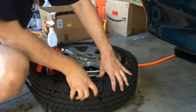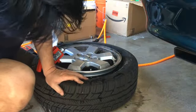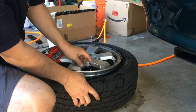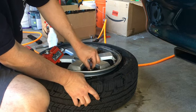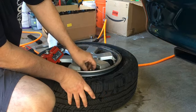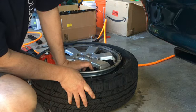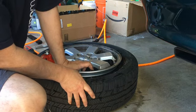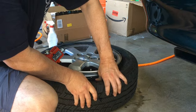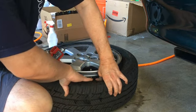I'm going through this relatively speedily because this is the third time I'm doing it. One thing to be aware of: here is the valve stem and the tire pressure monitoring system is attached to it — held only by a nut or shaft. You do not want to drop the tire pressure monitoring system inside the tire; you'll have to fish it out with some kind of grab tool. There's no way to get your finger in there to grab it.